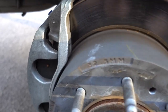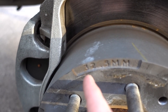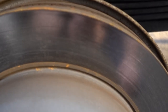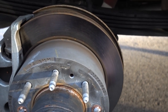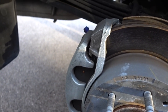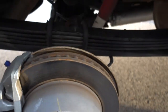These rear ones couldn't be turned anyway because the minimum thickness is 32.5mm and they're at about 34mm, but they don't really need to be turned because they're still in pretty good shape. Let's get started - this is actually going to take me more than a day because I've got to paint these calipers, which is going to take a while. Got to take them off, clean them up real good, and then paint them.